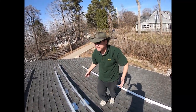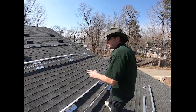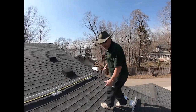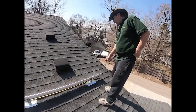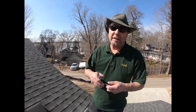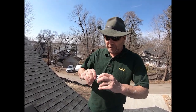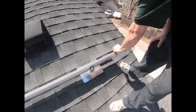Once you get your rails in and set, you want to get them at least locked down so you can do a measurement on what you're going to have to cut for the extra piece. Up here you can see I've got the tape measure all set. I did a little calculation and it turns out I have to go eleven and a quarter inches over on the end, and that accounts for one inch on each end for the mounting bolts and the mounting bolt spacer. So this is going to go here and you've got to make sure you leave room for that.